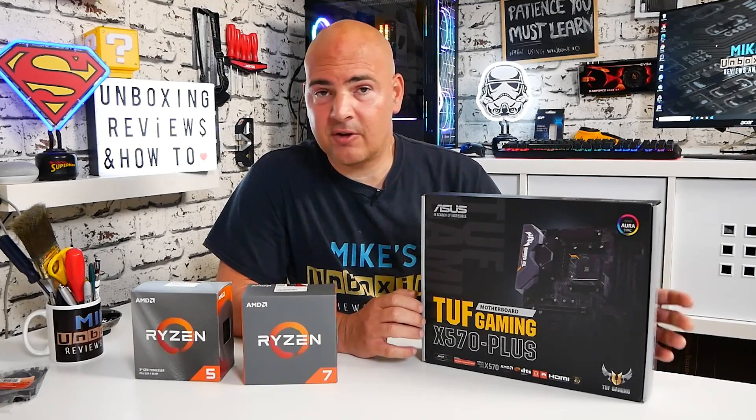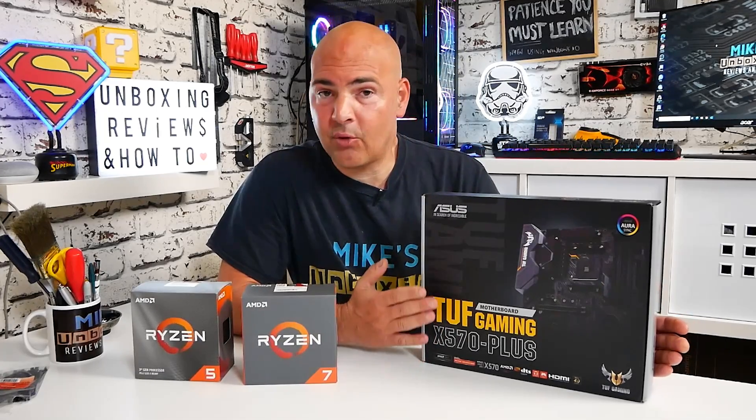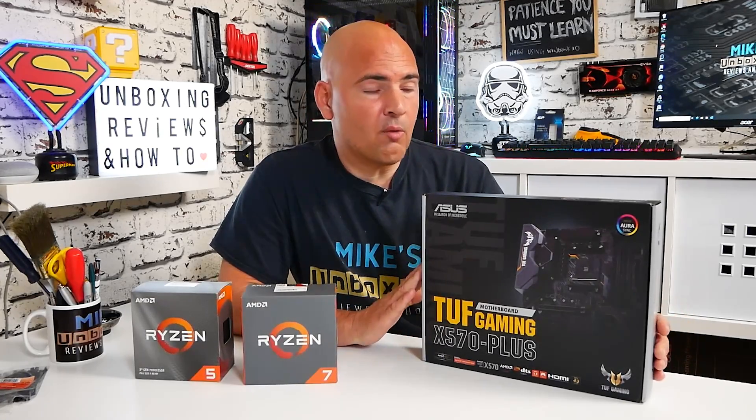This takes us to the high-end for AM4. The X570 is the top of the range, and we've also got the B550, which doesn't quite follow the budget-orientated traits you might expect from the 50 series. The new B550 boards are essentially X570 boards with slightly pared-down features — often a very similar or identical VRM set — but come in at a slightly lower price and lack features like PCI Express 4. If PCIe 4 is important to you for an NVMe drive or graphics card, you might be better off with the X570, spending maybe £20 to £30 more.